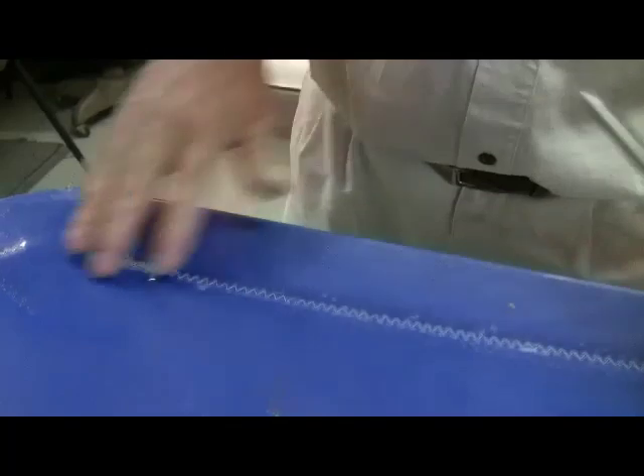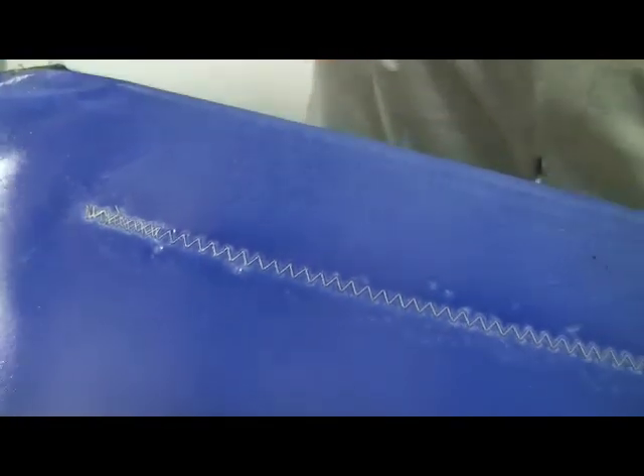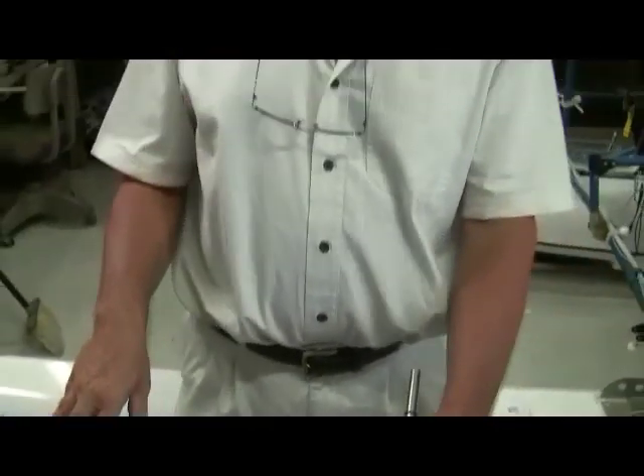This part of the rudder passed. You can see it just made a slight dimple but didn't go through. Because the top of the rudder failed, this surface is not usable. We'll complete the same test for both ailerons, the top and bottom surface of the wing, the trailing edge, the leading edge, the horizontal stabilizer, and the elevator. If the punch goes through, it needs to be replaced; if it doesn't go through, it's still serviceable. That's how the 600-33 Quicksilver sail test kit works.